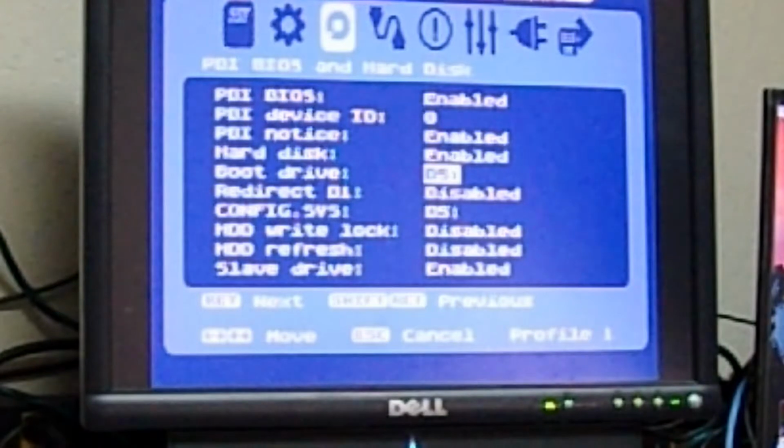You can have up to 15 drives on an Atari, but technically 16 because it's 8-bit. But physically, the physical drives like an XF551, a 1050, a Rana, whatever, can only be set to 1 through 4. Yes, I know the 815 by Atari could be set up to 15, but nobody has one of those except for the rare few, so it's not really an argument, is it? Sorry, that was for the peanut gallery.